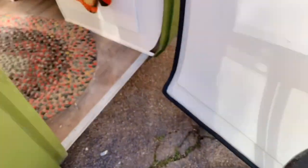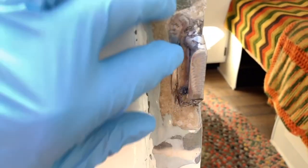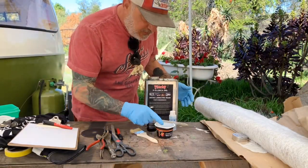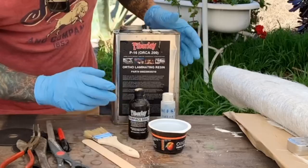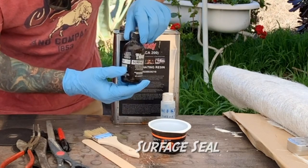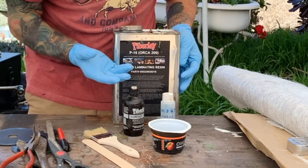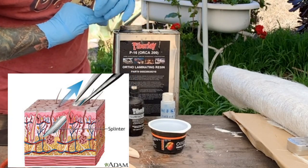Now because I had to grind all the fiberglass off down to the bare metal so I could weld, I've got to re-fiberglass this right now. I'm going to mix up some fiberglass — I got these little pieces I cut, and I measured and pre-cut all of them in order so that when I start to do the work, I'm ready to go. You don't want to mix up your resin and then start measuring and cutting fiberglass. For the fiberglass, I'm using laminating resin and a product called Surface Seal, which makes it so that when everything sets, the fiberglass isn't sharp and won't poke you — because you don't want fiberglass splinters, they don't break down in the body.